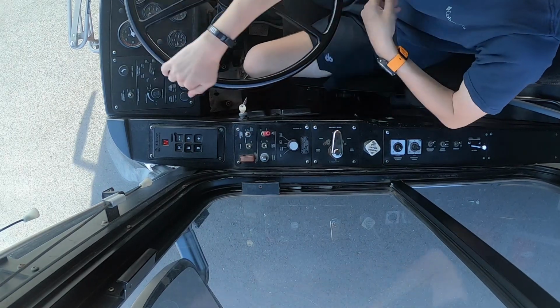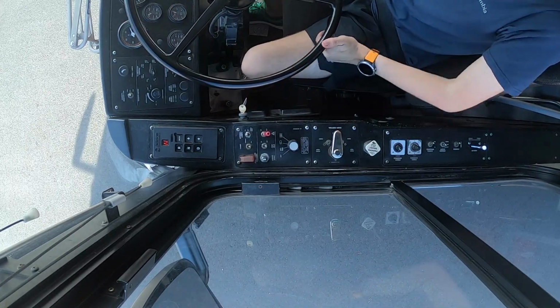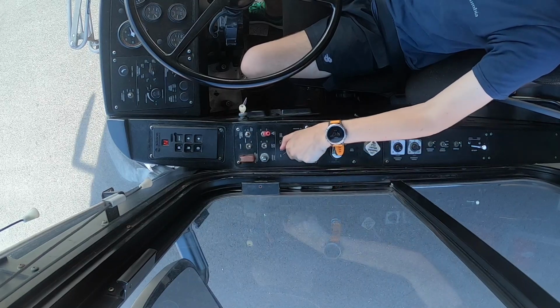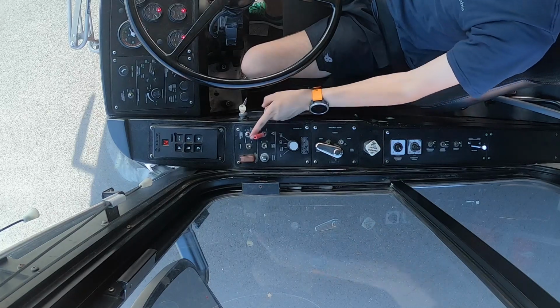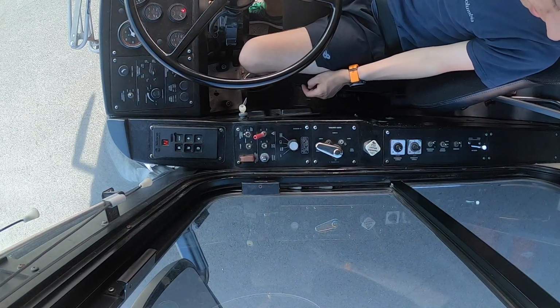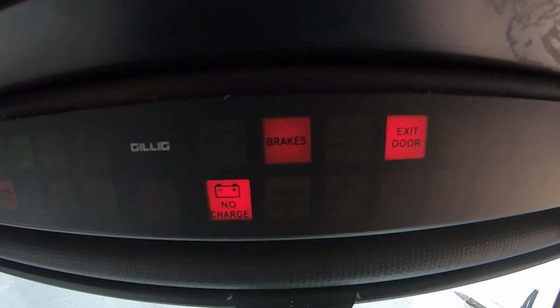The pre-trip inspection: turn the steering wheel all the way to the left, then turn the bus off and set the run knob to the lights position. Open both the front and rear doors and turn on the hazards and all of the interior lights. Finally, turn on your high beams and leave the seat, taking the key with you to chock the rear door side tire.